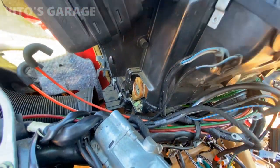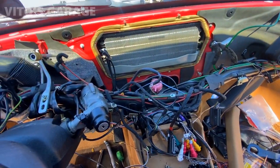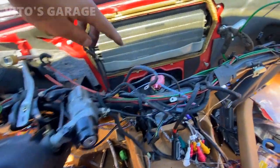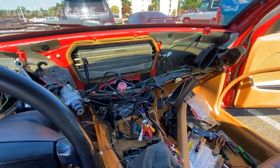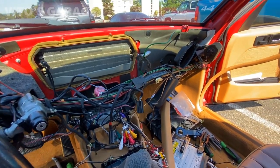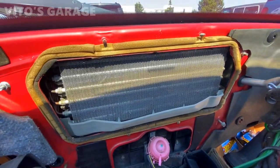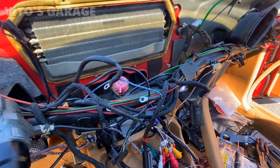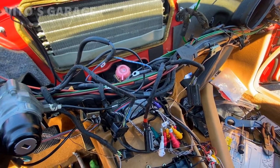Here's the leaky, horrible original heater core. Now it's a perfect opportunity to replace whatever parts you want — it's a good idea to replace the blending flap lock assembly while you're here, and all the vacuum actuators. I have a couple of new vacuum actuators but I'm going to test the existing ones first. As you can see, this is the evaporator right here — make sure you keep track of everything you take off so you know where it all goes.